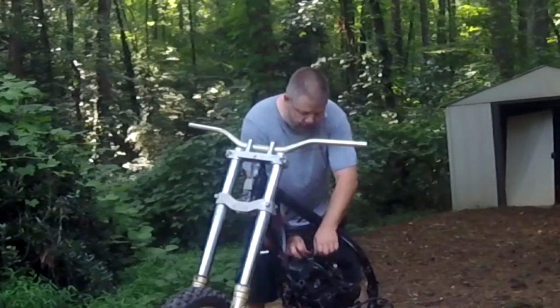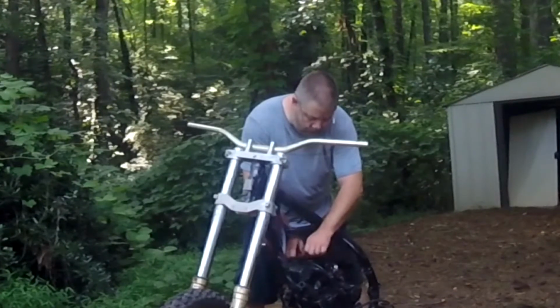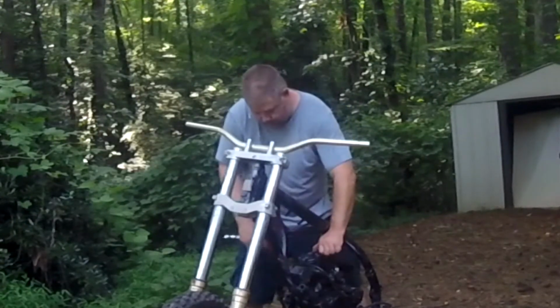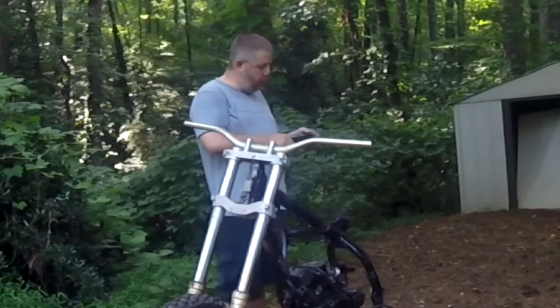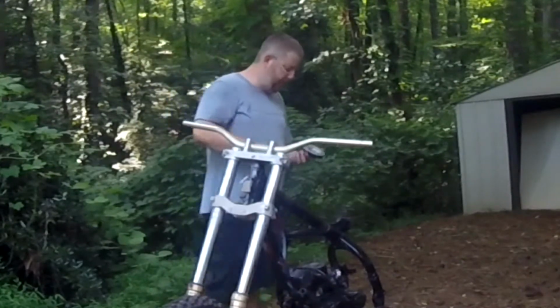Yeah, these nuts are just slid back down on here. They couldn't get this running, and they took it all apart and just put everything back finger tight. Okay, I got a nice, good, flat, smooth head, which is nice. That means to refurbish it, all I got to do is put it on a flat plate.